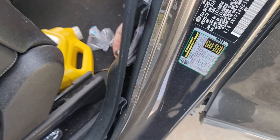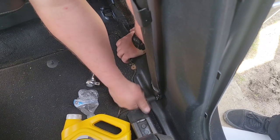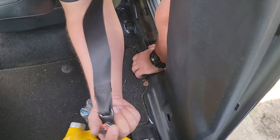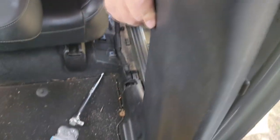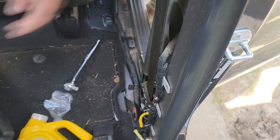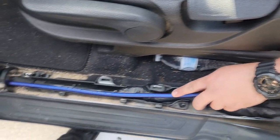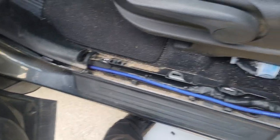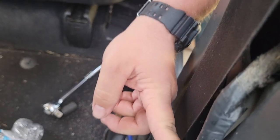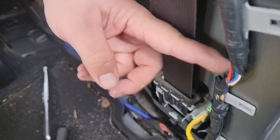Now we're going to run the wire behind the B-pillar. This is a 14mm socket. Once you loosen it, you can pretty much hand-thread the rest of it. Once it's out completely, pull it out of the way — do not lose any of this hardware, because if it falls off it's going to be annoying to find. Hang it right there out of the way. As you're getting the positive back here, you want to make sure you stay in that wiring channel. If not, it's going to get crushed or crimped, and you don't want it to short out on the body. You want to get it behind as much as possible, or run it under the carpet in that channel right there. And while you're here, we're going to have to get the positive and negative of the speaker.